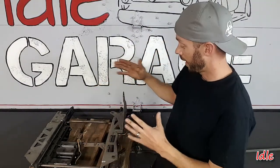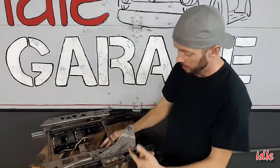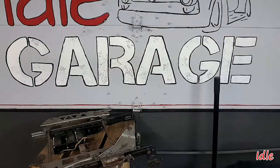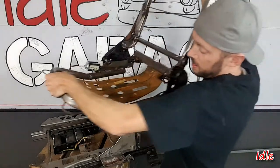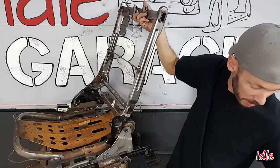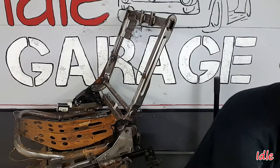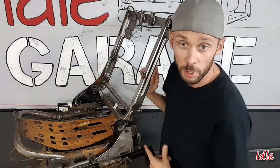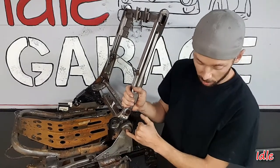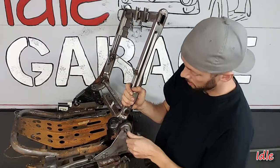Here's the car frame. I took a good look at this and came to realize that this bracket right here lines up pretty good with this existing spot right here that had this frame going. Being that was already a mounting point, we're going to make it a mounting point again. I cut the nut off the back side of that and then it fits in there like so.